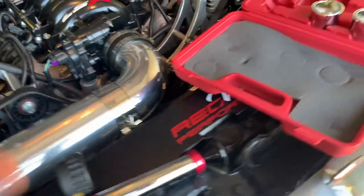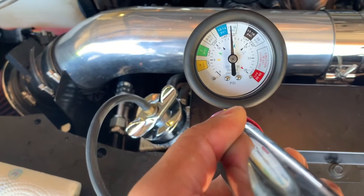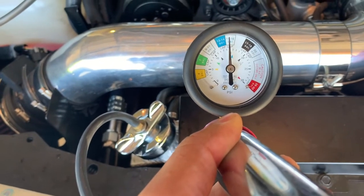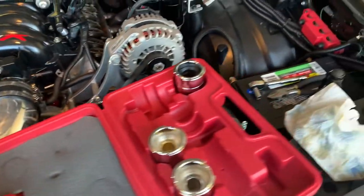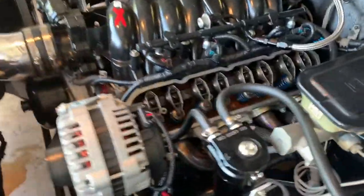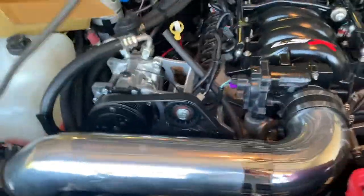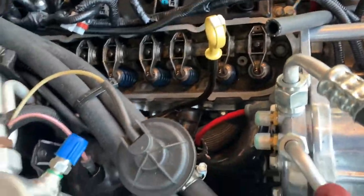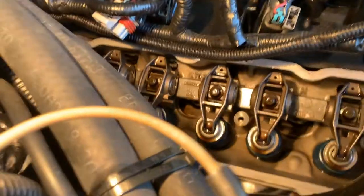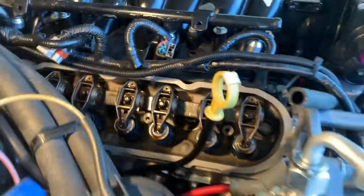It's holding pretty good — went down some from last time I looked, but once you get that 16 psi maxed out, that's when it starts leaking. It'll leak even more when the engine is running under pressure all the time. I found the leak on this side; I hope there's not one on the other side. This side right here is the clean side of the motor, and the engine doesn't have that many miles on it.